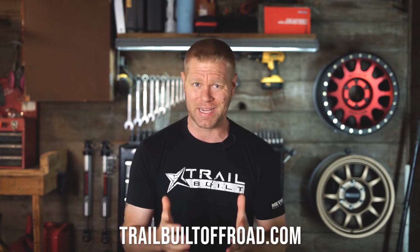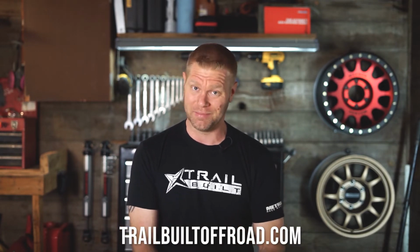Now, to answer the question of which setup is going to be better for my particular off-roading needs, well, in general, you'll want to more than likely stick with a short arm suspension lift if you don't plan on lifting your rig more than 3.5 inches and it doesn't need to be a rock crawling machine. And also, if you want to keep the initial investment cost lower on the suspension because you still have to purchase your wheel and tire package from trailbuiltoffroad.com as well.